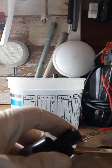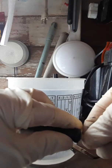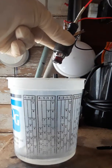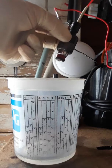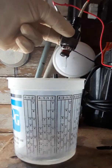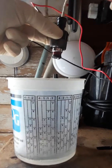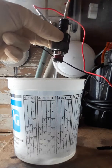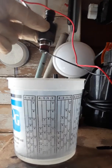So I'm going to stick the straw into that little hole where my tape is. Kind of push it down in there so it can take up all the space. And then when you spray, you see it spraying out the bottom of the fuel injector. That means it's cleaning it out from the inside, which is what you want to do. You want a consistent flow. You see all that stuff spraying out on the top, but that's okay, it's going to do that. But what you want is to clean out the inside of it by spraying through it with the power running to it, just like this. See how it's got a consistent spray coming out? Well, it's not 100% consistent because I'm running out of brake cleaner, but you guys get the idea.